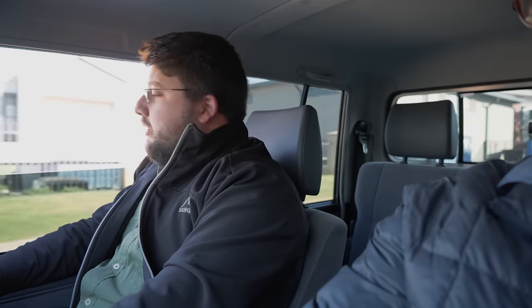So last night we finished up the whole brake system. We got the new braided brake lines in. We've got the dual diaphragm brake booster. Roelfie's busy messing with the brakes with me right now. It's a marked improvement. What do you think, Roelfie? It's difficult to describe, but the brake booster was already a huge improvement, and just changing 3 out of the 5 flexible brake lines to braided hoses.